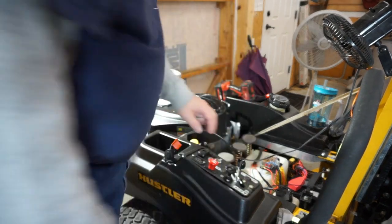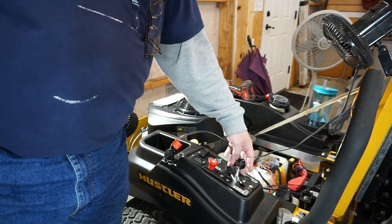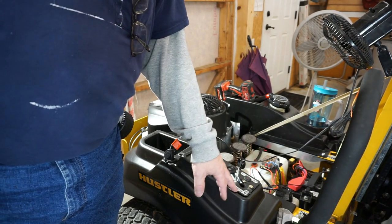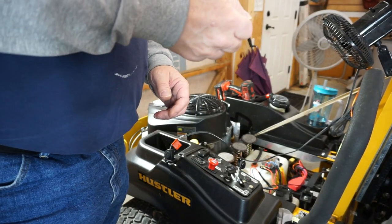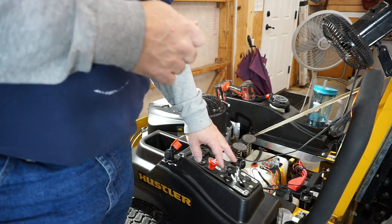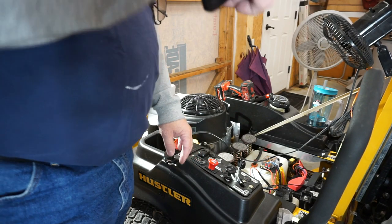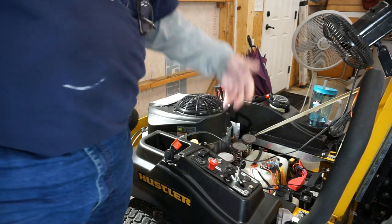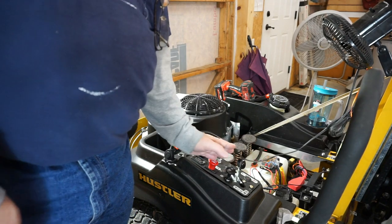I'm going to put the ignition switch here. I'm going to move the choke over to here. And the throttle cable will come up and forward to here. So that as you are starting the engine, as you get to the start point, the choke should be closed. When the engine starts, then once it fires, you just lean your hand to the right, and that'll push the choke down, which opens the choke butterfly. The rest of these things will all be moved forward.